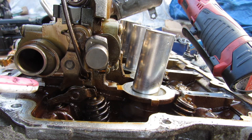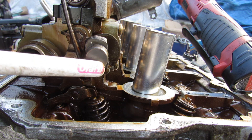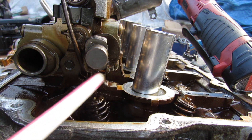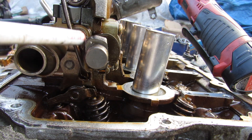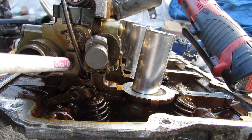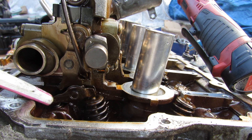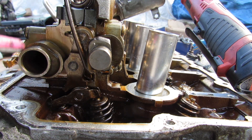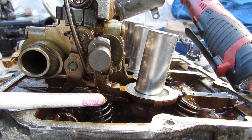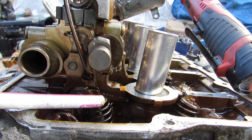To demonstrate how BMW's Valvetronic works, we're going to take a look at this mechanism here. We've got our eccentric shaft, which is powered by that spiral gear we saw earlier, and it's got this cam profile on the outside that touches this roller rocker arm system, which has a double pivot and contacts the actual camshaft. The angle of that then affects the contact with the roller, which is the one pressing down on the valve on this side, with a hydraulic adjuster on the other side. At the current position the camshaft is at its maximum profile, but the valve itself is at its minimum profile because of the angle of incidence, bringing the valve to an almost closed position.